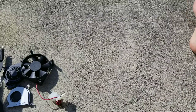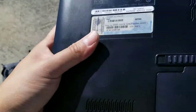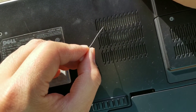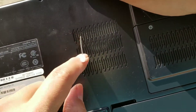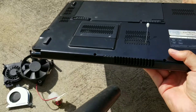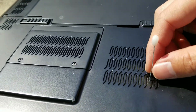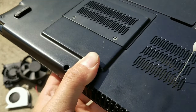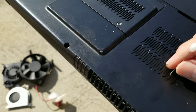For the laptop demo — there are so many styles, so I'll just show this one. Stick the needle in where you see the fan, usually closer to the outside of the circle pattern. Now the needle is in there. If you're using a powerful air blower, start further back so the air isn't too powerful at first, then slowly move it closer. Hold the needle and you can actually feel the fan fins hitting it — that's how you know it's properly blocked.